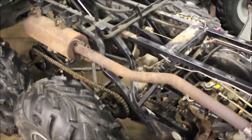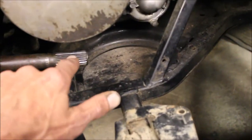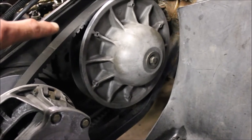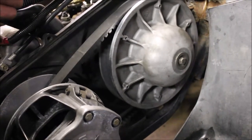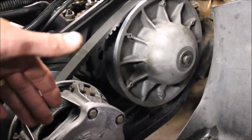I found out this thing only had 2,700 miles on it and she looks really clean. My last things to do are put in the front driveshaft for the four-wheel drive, get that cover on, and adjust my clutches. There's a shim that goes behind the secondary — one transmission had one size shim and another had a slightly thicker shim. I went with the thinner one and I noticed the belt is making a goofy noise, which tells me the secondary is probably in further than it needs to be. I'll get everything lined up and this bad boy should be good to go.